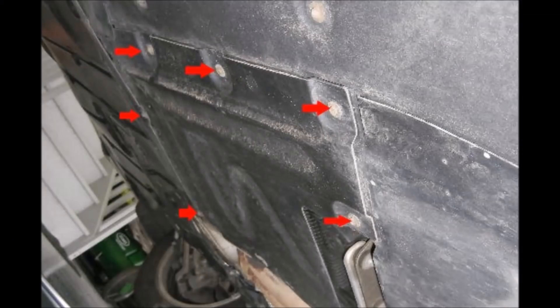The first thing you're going to want to do is jack your car up. I don't have a low-profile jack, so I actually had to run the car up onto blocks to get it high enough to get under it. Once you get it up, you'll notice your main plastic cover underneath the engine with a smaller one behind it covering the transmission. It's held in by a few 8mm bolts — remove all of these and unclip the plastic sheet to expose the transmission pan.